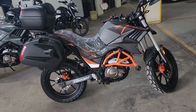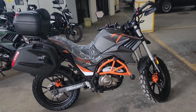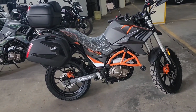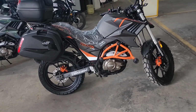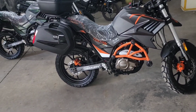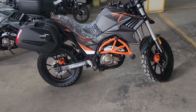When you reach 1,000 kilometers, bring your bike in for service. Give us a call. We'll send a mechanic to you, or you bring the bike in. What we'll do is change the oil and put in the actual synthetic oil, a liter, maybe 1.1 liters, because of the oil cooler, and then we'll change your spark plug for you. After that, you can continue up to 2000 kilometers, still maintaining 100 kph.